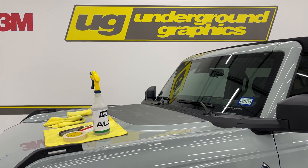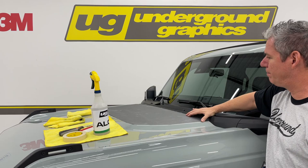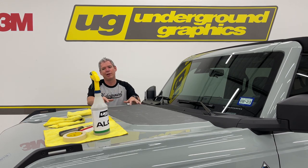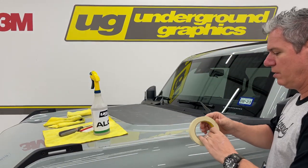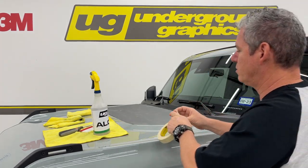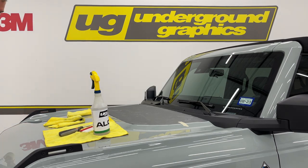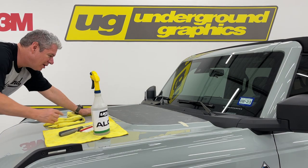This is already cut to shape. You want a little bit of paint showing — about a sixteenth to an eighth of an inch. Position it yourself and make sure you've got it where you want it on both sides. Use a couple pieces of masking tape to hold it in place as you get started. I like to do one piece per side, matching that same gap. We're going to use a hinge method. I've got a little step stool — if you have the steel bumper you can step on that. These hoods are never comfortable to work on.